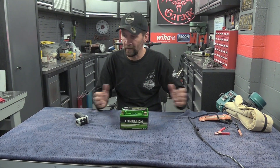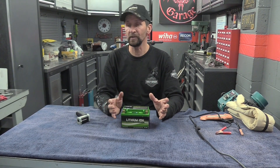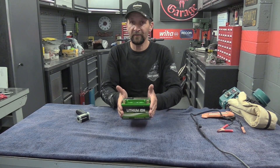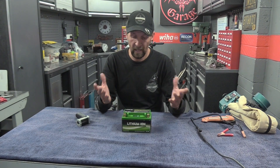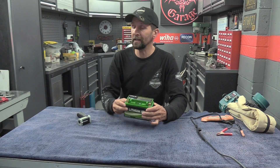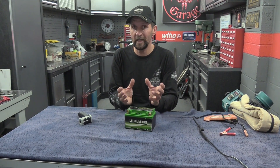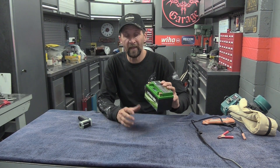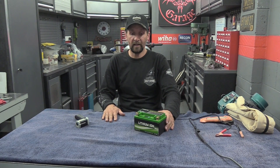So if you're going to buy a lithium-ion battery for your bike, buy the absolutely correct one that is approved for it — the manufacturers will have tested compatibility with your charging system. An incompatible battery could damage not just the battery but your bike's charging system too. For today's test: the headlight test left it on for 15 minutes taking around 20% charge, stayed room temperature; charging for 40 minutes pumping that power back in, stayed room temperature. I'm happy to put that battery in my steel battery tray. I'll keep a close eye on it and may vent the box a little more, but I think that's a good result. I hope this helps the guys at Wiimoto too. Have a wonderful Sunday — ride safe, whatever battery you have.